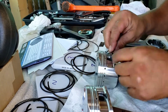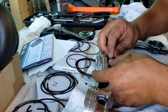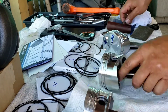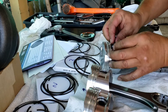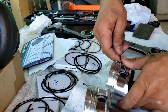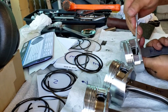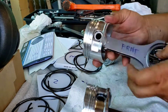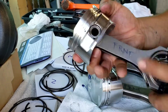Last thing I don't want is this thing coming off on me. Put the end in, squeeze them together and push. All right, again you're gonna hear a click. I want to verify everything is in — both sides. My marking corresponds to that mark — marking the piston, the tabs on the exhaust side. Verify right there, mark the tabs — cool.